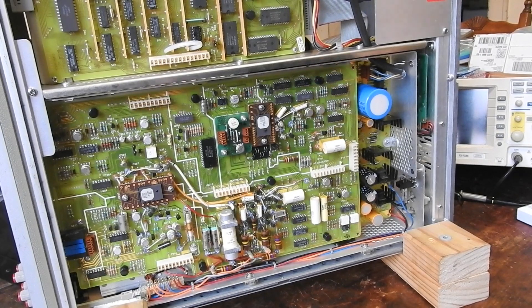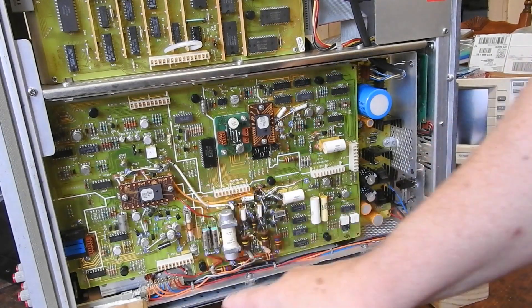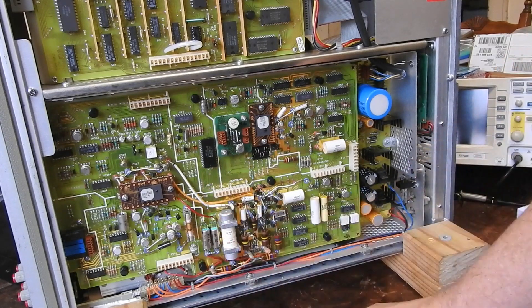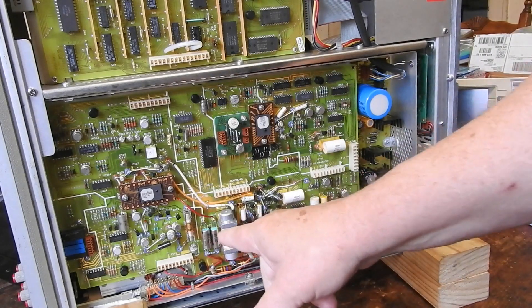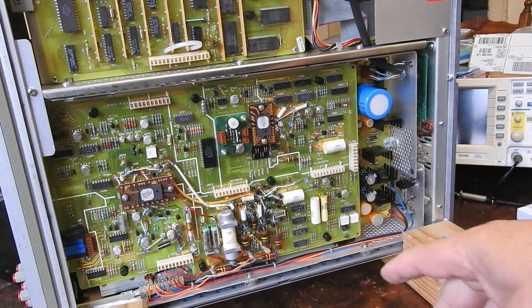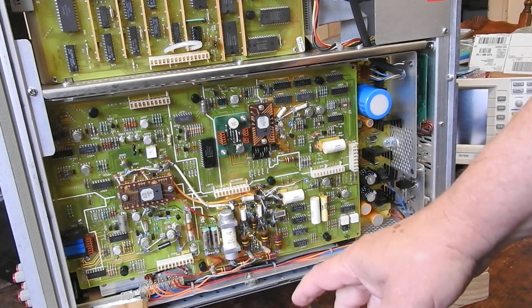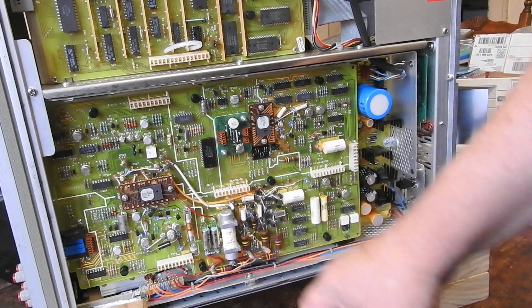To identify where that noise is, I'll turn it on — it's coming from around there. There are three little relays, or two little ones and one large one. I've tried listening through tubes, using solid things like a screwdriver up to my ear touching these things, and I can't discriminate which one is causing the noise. But from the racket I'm thinking it must be the big one — but we'll find out.